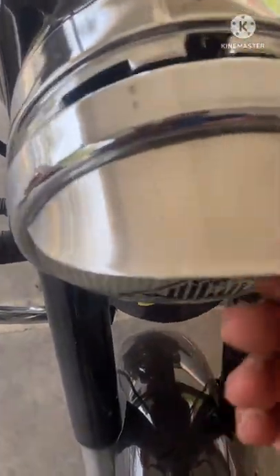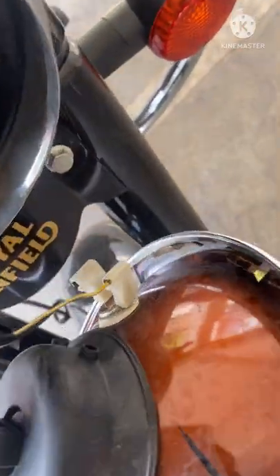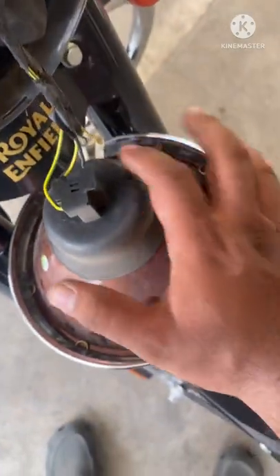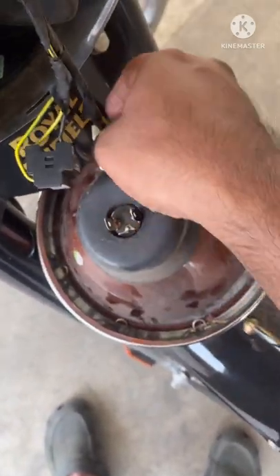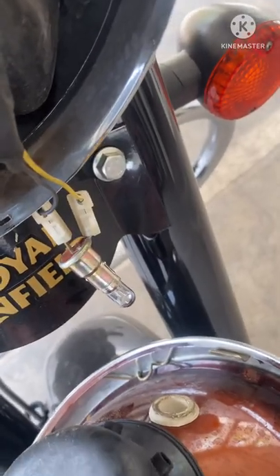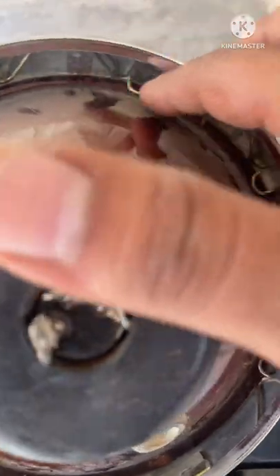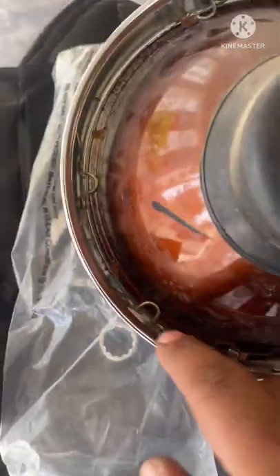You can see this is popping out. If you can see this part — that's it. Now you have to remove these wires; you need to remove these connections. You can just pull out the small parking bulb from this hole. As you can see, these are the clamps we need to take out. I can't find my cutting plier right now so I'll just use the minus screwdriver.